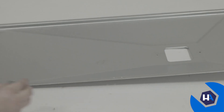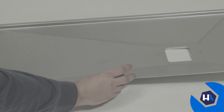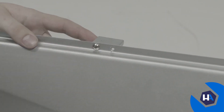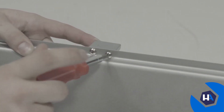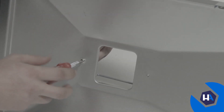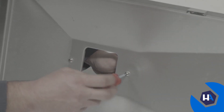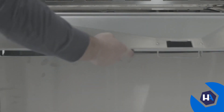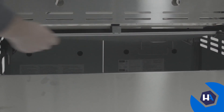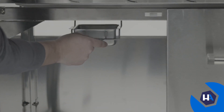After that, find your grease tray assembly. To assemble your grease tray, attach the grease tray stopper using two B-screws. Then attach the grease tray bracket using two more B-screws and two D-washers. Once your grease tray is fully assembled, simply slide it into the back of the grill. Then from the front of the grill, insert your grease cup into the grease tray.